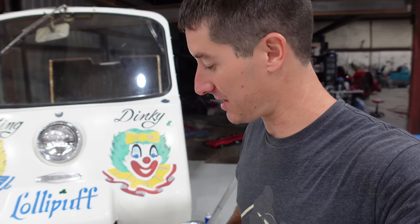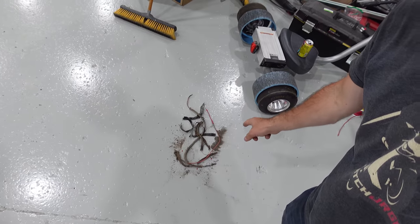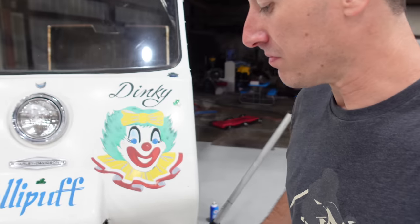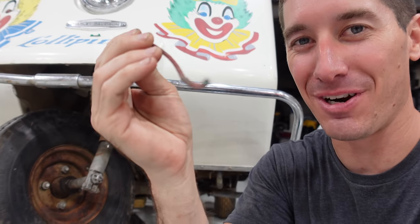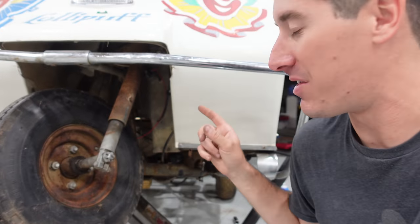I started cutting because that was really the right thing to do. So far I've ripped out this much of that junk cloth wire — we're going to replace all this with modern stuff, nice wire with split loom tubing over it. We'll tape it all back up and make it nice and out of the way. But then I lost power at the ignition switch and I was like, what? How? The wire literally just fell apart — it's corroded all the way through right there. So now I've got to rip out the main wire that comes from the starter relay, bring that all the way back up to the front, and then maybe it'll run.